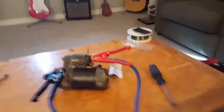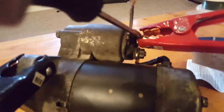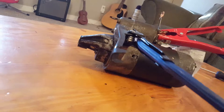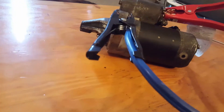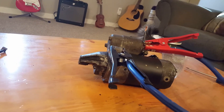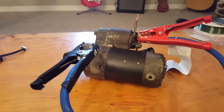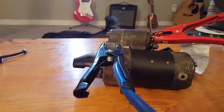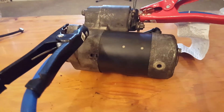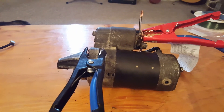If it's making some noise, take it apart, remove the cover where the planetary gears are, and pack it full of grease. I use the same grease I use for my ball joints — a starter isn't used that often, just for about four seconds every time you start the vehicle, so really any grease should be fine. If you want to use something proper, Google will have the answer. If this video helped you repair your starter without spending $60–$100 on a brand new one, give it a thumbs up and subscribe for more. Thanks, bye!